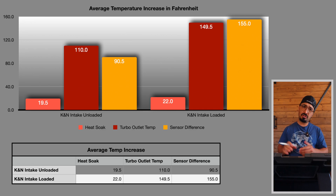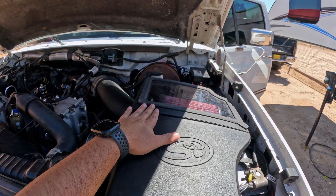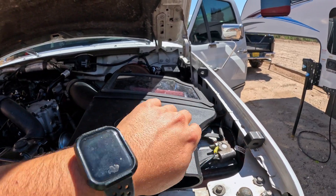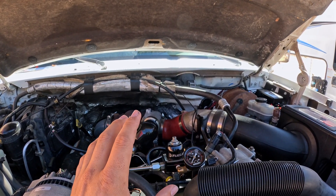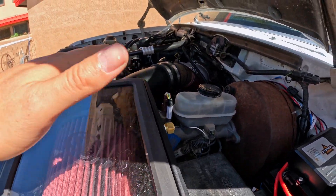There's also a third chunk of data showing the difference between both readings — if you take 110 and subtract 19.5, you get 90.5. This will be more important for the intercooler follow-up video. Now it's time for the S&B cold air intake test. We have cold air flushing in through the front only — the side plug is plugged up so we're only getting fresh air from outside — and no intercooler. We have a sensor reading the intake temperature after the turbo and an ambient temperature sensor inside the box.